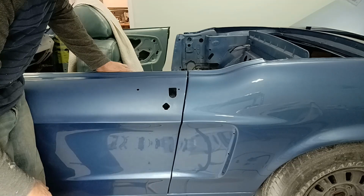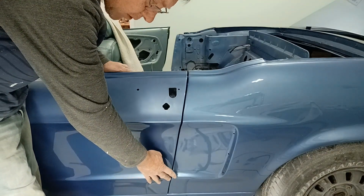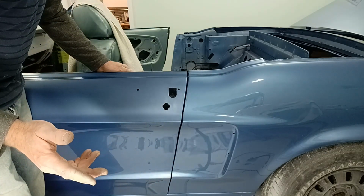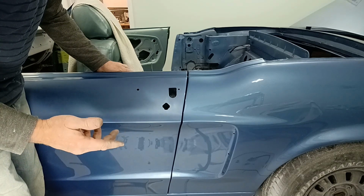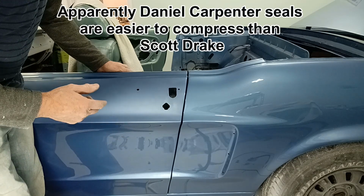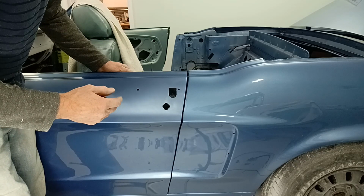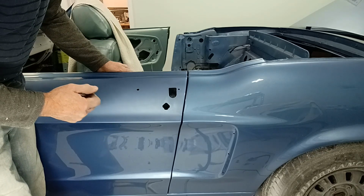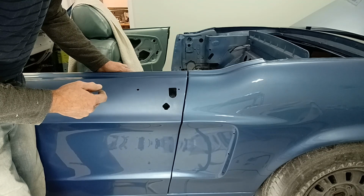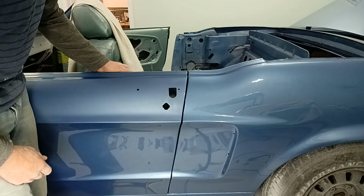The option I have is, again, see if that breaks in, or I can trim the seal, or some of my subscribers have mentioned there are multiple manufacturers. And although Scott Drake is one of what you would call, I don't know if you call him a premier manufacturer of replica parts, his seals are actually very hard. They are an extruded rubber. So other manufacturers make a much lighter seal. So that could be an option, is to change the seals out.